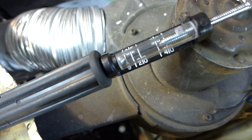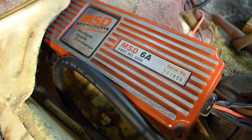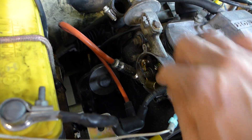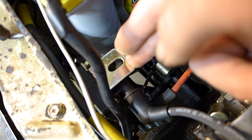What I'm going to show you now is I just installed an MSD box, which is an MSD 6A. It's a very common MSD product — it's their base, meat-and-potatoes capacitive discharge box. It takes the trigger, which is basically your points right in there, and amplifies them tremendously in the box. But you've got to have a coil that can handle it, so I put on an aftermarket two-tower coil that's rated — I think it's 60,000 volts — something like that. It's a modern coil.